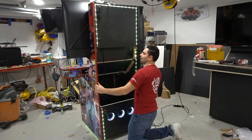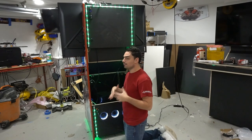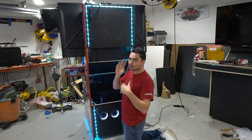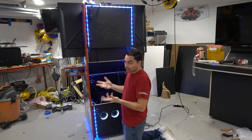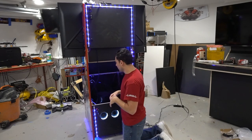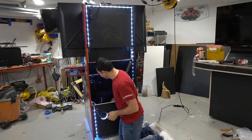So basically the one thing that I did learn, especially with doing this for years, we have to make sure that the USBs get connected back in its correct order. You have to connect the USBs back. If you don't, you're gonna mess up the IDs. That's the only one thing, but I'm actually doing this now. I'm gonna take a picture of it and then I'll make my adjustments and all that. But basically this is why I can't have beautiful wiring, because you could essentially disconnect the computer.